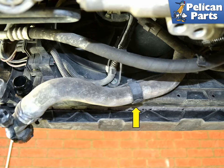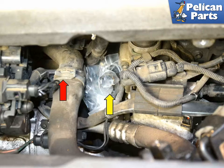The lower hose is also attached to the radiator by a plastic clip (yellow arrow) that just unclips. The lower radiator hose attaches to the thermostat housing, and there is a fair amount of work you need to do to get access to it.